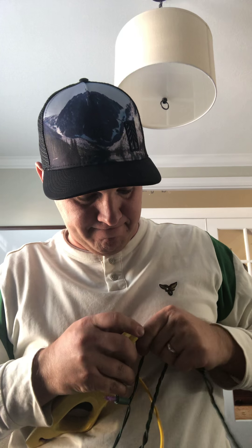I'll go ahead and pull this one out. Visually inspecting the light, I can see it has contacts on both sides and they're in place. A lot of the issues I've been having with my lights is these contacts — they just get corroded and break right off. This LED looks like it should work, so I put it in the bulb tester. It's kind of lighting up — I can tell it's got a problem too.